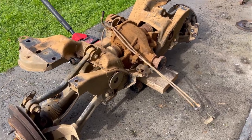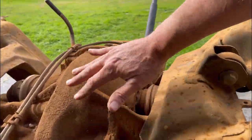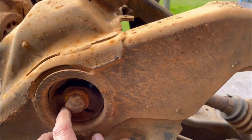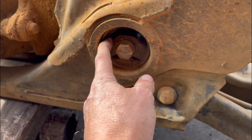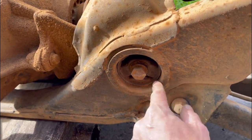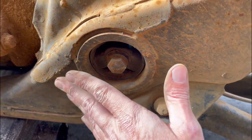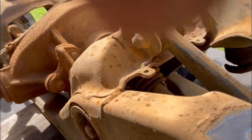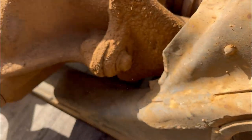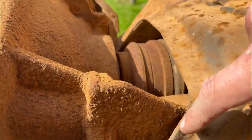Couldn't be bothered waiting so I've decided to drag it out and have a quick look at it — it's covered in grime. It's going to need a good clean up. Here are your factory diff bushes — the factory rubber ones. I've bought rubber-type replacement ones because they're easier to put in. A tip that a lot of people miss — they don't sit the new bushes in far enough. They'll get them in and because it's hard to get them past flush, they think that's enough. But it's not, because then you have issues with the diff casing fouling on the cradle just here. That's why you need to press them in that deep — just a bit of a tip.